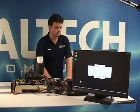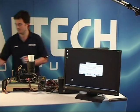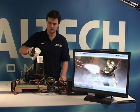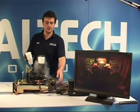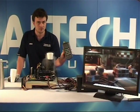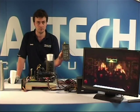The current temperature is minus 68 degrees. Okay, let's start the 3D test. So the idea is the temperature has dropped fairly quickly to minus 63, and I've put in more liquid nitrogen so that I maintain the temperature around minus 70. So the idea is to keep the temperature in that range. If you go past minus 85 or so, you're probably going to force the motherboard to shut down prematurely because it's cold bugged. This is an operating cold bug now.